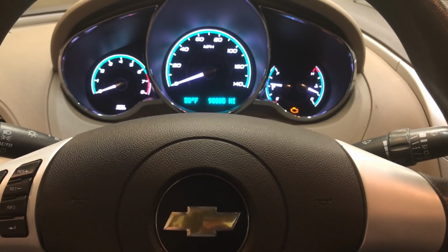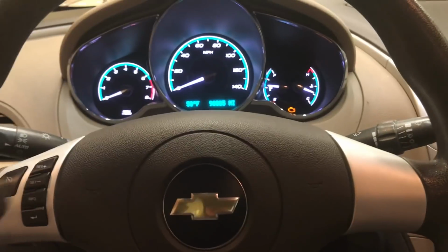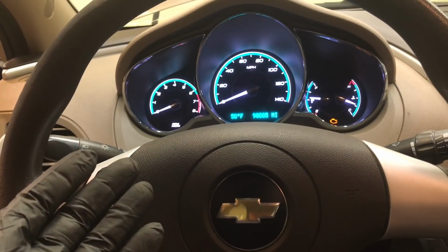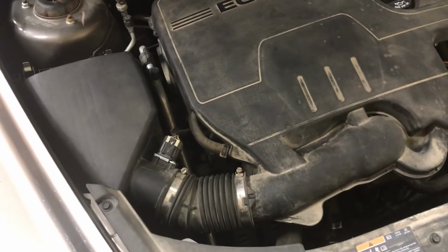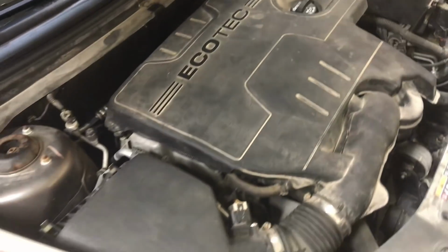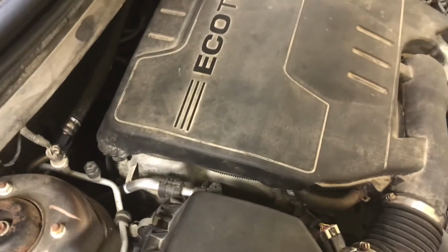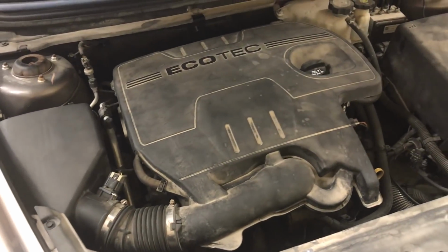It requires special tools. You've got to have the right equipment. Usually having a lift is going to be a big help. What I'm going to do in this video is drop the engine and transmission on the subframe, or the cradle as some people call it, out of the vehicle. While it's not 100% necessary to drop everything out of the vehicle like I'm going to be doing, it does make it much easier to work on once you've got it all out. There's a little bit more labor involved with dropping the subframe along with the engine and transmission, but since my lift only goes up about 48 inches, and for the purpose of making a better video so you can clearly see what's going on, I'm going to be dropping everything out, so you get an idea of what you're getting into should you do this work on your car.